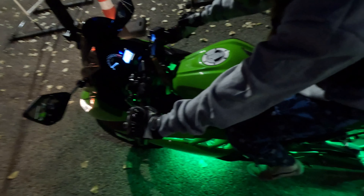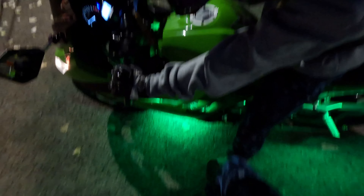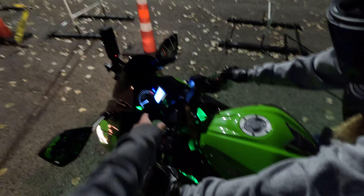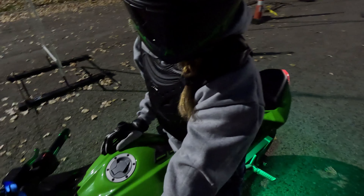Just go click it up all the way. There, that's up. See how you clicked it up fully and it's in neutral? That's what neutral lock is. So that means no matter how far up you go, you're always in neutral if your bike's not moving. But if you're moving and there's gas, it'll go to second. Okay.